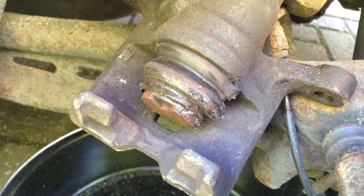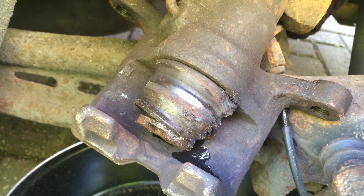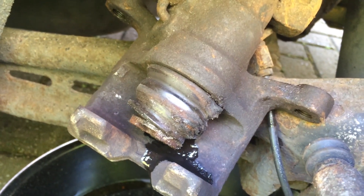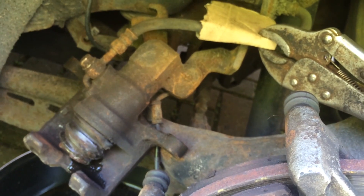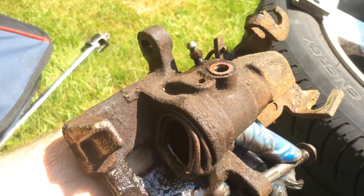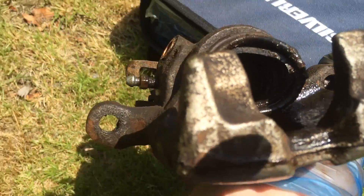There's a bit of oil — we'll go a bit further. The piston's not moving any further, so now put the clamp on the hose pipe to stop any more oil leaking out. Now I've disconnected the hose pipe and the whole unit is free away from the car.